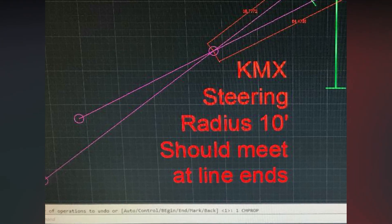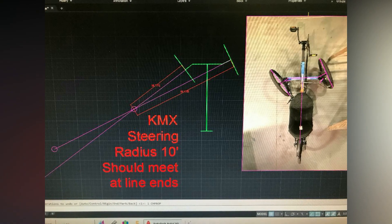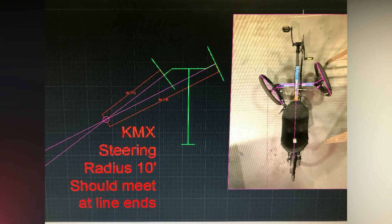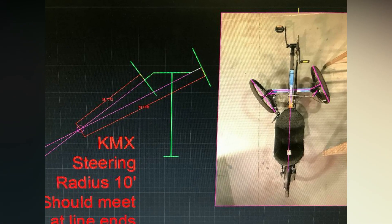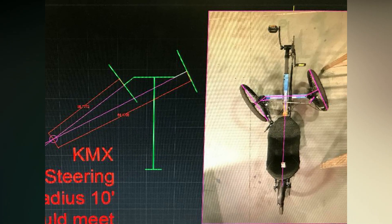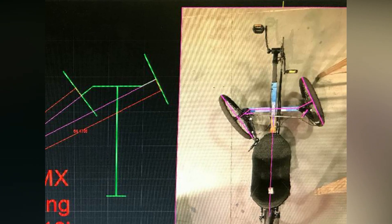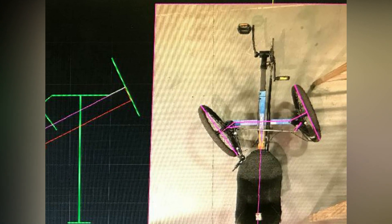Being so close together, they don't need this sort of angle though, and I'm not sure where they came up with this. This is from my KMX — a production bike. I looked to see if there was any accident it had been in or any cause where these angles would be so far off, but I couldn't find it, so I could only determine that they meant to do this on purpose. It became very obvious that this was a source of its twitchiness. The ones I've ridden have a certain inherent twitchiness that only gets worse the faster you go.